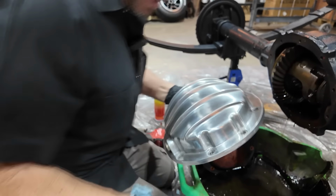All right. I don't even know what that is. That's where they go. That's the OE one. These are in good shape. What I am going to do, since somebody forgot to take these out or plug the threads, I'm going to run a bolt through here and chase the threads out. But down here is where we're going to put in the new clips that fit perfectly.